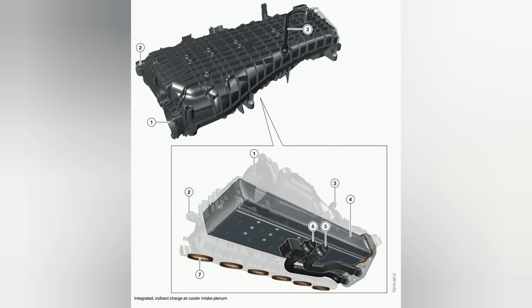I'm going to try to condense my explanation of max cooling mode just to make sure we're all on the same page. Our cars are water-cooled — the engine has coolant flowing through it, but we also have an air-to-water intercooler. Because of that, we have two completely separate cooling systems that operate independently. We have the high-temp circuit, which controls cooling for your engine, heater core, turbo, and main components running at over 200 degrees Fahrenheit. Then you have a separate low-temp circuit for your intercooler and AC condenser.